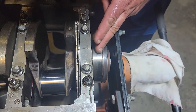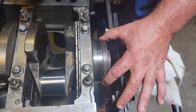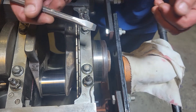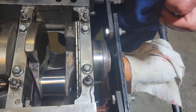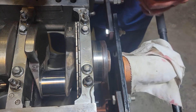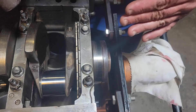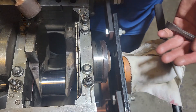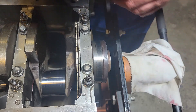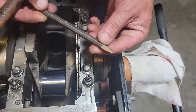The later blocks do have the shorter crank and they put spacers in there, so we're going to see if this comes off just with a chisel. I'm doing this right after installing new bearings in the bottom of this motor, which I really shouldn't do because whacking on it is going to put stress on the thrust bearing. But if it comes off easy enough it won't really hurt anything, so we're going to give it a try. I'm just going to take my chisel — this is nice and sharp.